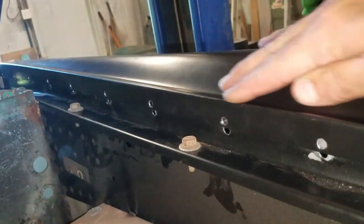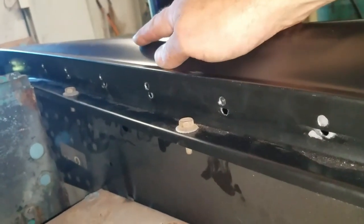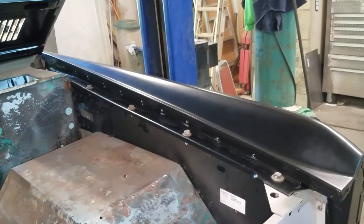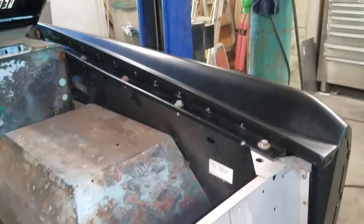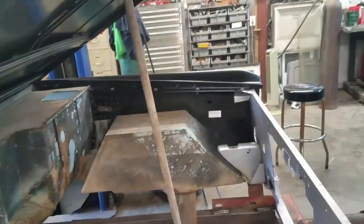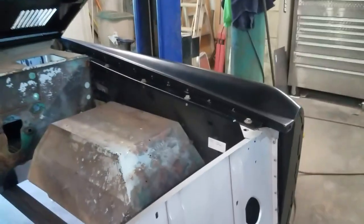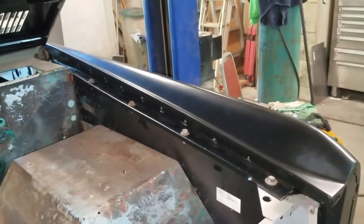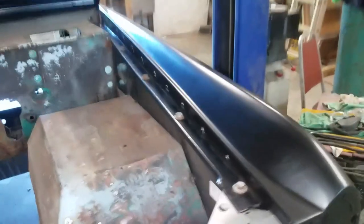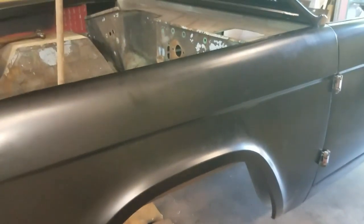I think this radius will pull right down to the hood. All my panels are where they're supposed to be and dimensions are correct, so this is just some of the stuff you have to do. You may not have to do this to all fenders — this is an Oval brand fender, I haven't dealt with them before. I know Oval brand was the brand on the rockers and we know how those turned out. Other than that, the fenders have really nice bends and radiuses — the skin looks really good, it's just the structural fitment part where I've had issues.